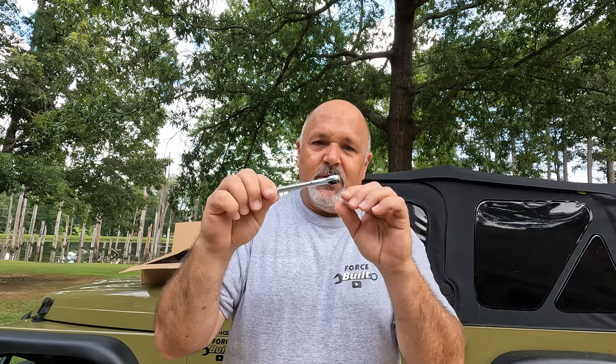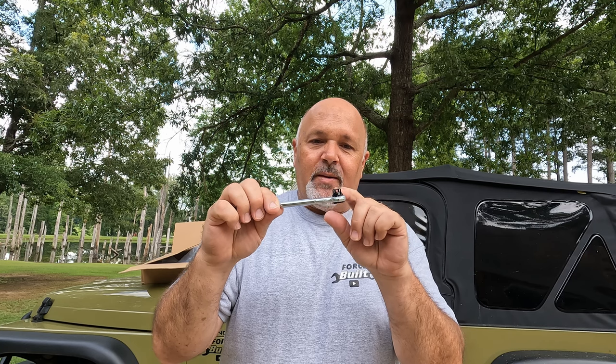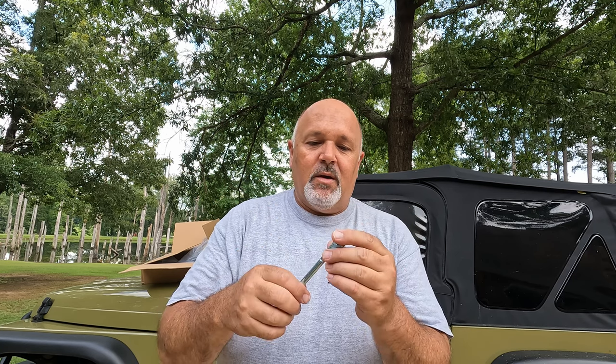The master and the slave cylinder, along with this new pin. The previous owners came up with something on this piece right here that they modified that I absolutely agree with — they did a really good job on that. They do not use this plastic piece that snaps into this hole that holds it onto the clutch pedal, because this plastic piece is prone to fail and you can't get it anywhere. I drew one up on a 3D printer and printed it — it's too fragile, it's not going to work. So they've used a clipping pin off of a receiver hitch, like on a truck, and clipped it over the clutch pedal. It works great. I didn't know it was like that until I got to looking to see why my clutch pedal came in and out like that. I saw what they had done and I'm going to reuse their idea — kudos to the previous owner on that one.